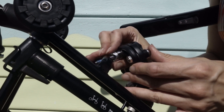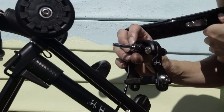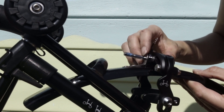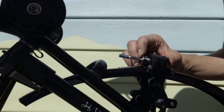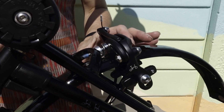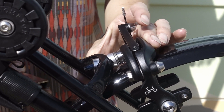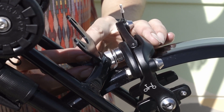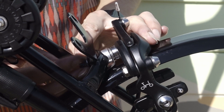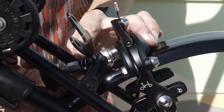Next we're going to remove the brake caliper and take out the concave washer. Slide the mudguard in place, then pop the brake caliper through the mudguard. Put the concave washer onto the brake caliper and put it through the frame. Now we're going to finish reassembling the rear brake: concave washer, followed by the light bracket, then the spring washer, followed by the washer, followed by the lower stop disk.